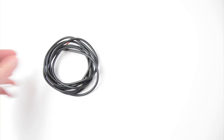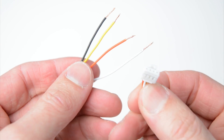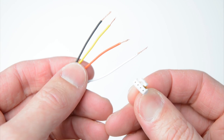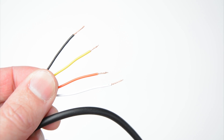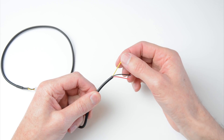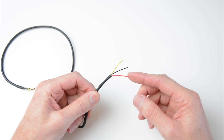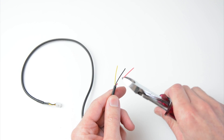There are two main sets of wires included with the boost gauge. The first cable has four grouped wires: black for ground, yellow for accessories, orange for power, and white for illumination and dimming. The second set has three grouped wires for the sensor. From this group we will only require the signal wire — the other two red and black wires can be trimmed.